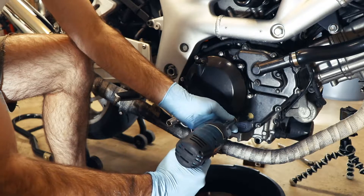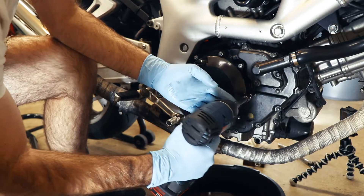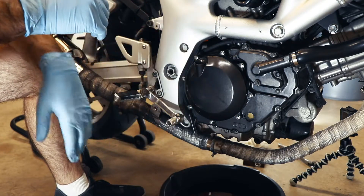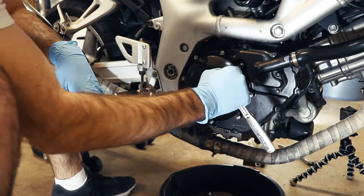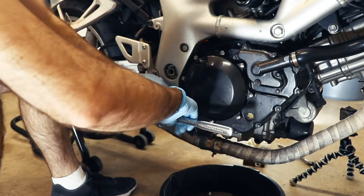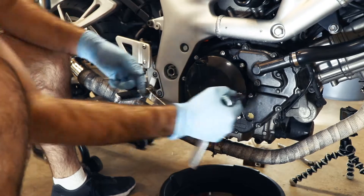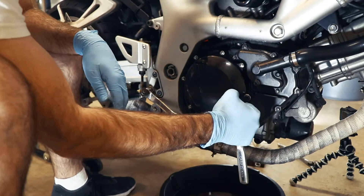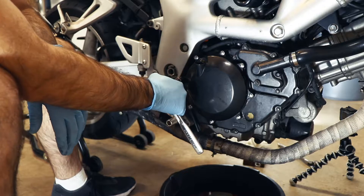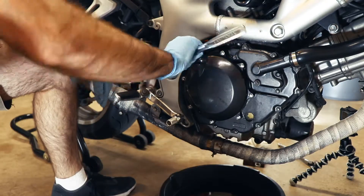Note that I am not going ham on the torque. We've now got all of our bolts in and run down so that they're holding this in place, and now we want to tighten them. I've done enough wrenching in my lifetime to know what tight enough feels like on an 8mm fastener, so I don't feel any particular need to use a torque wrench on these. If this guy who can do this by feel is not you, then by all means use a torque wrench. Nobody ever used a torque wrench and regretted it. Well, actually that's not true — I've used a torque wrench before and snapped bolts anyway. But what that was probably telling me is I needed to replace that bolt, and the fact that it snapped was probably a blessing.